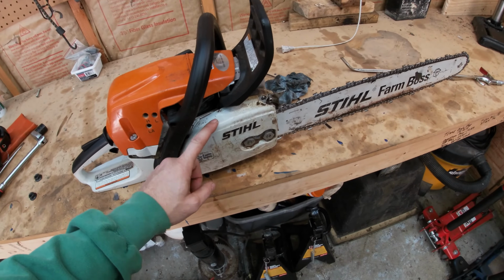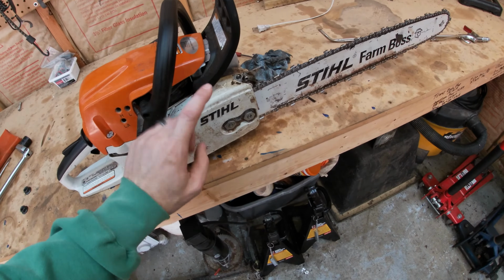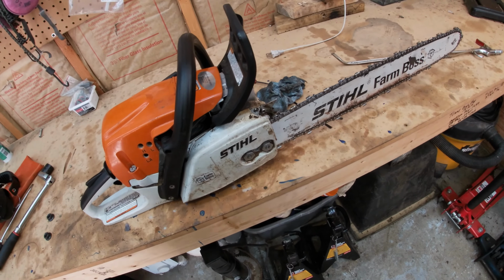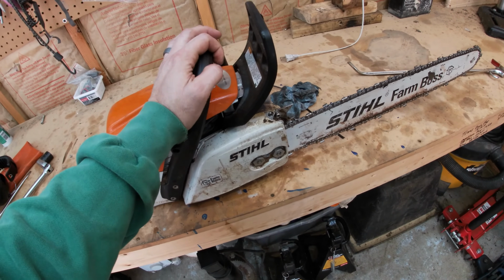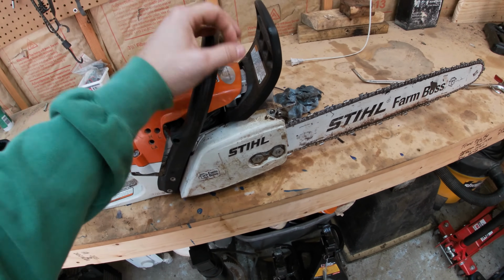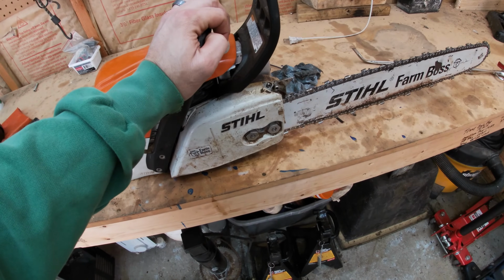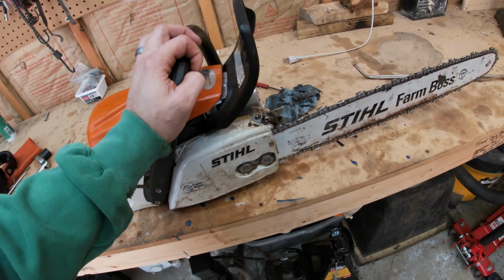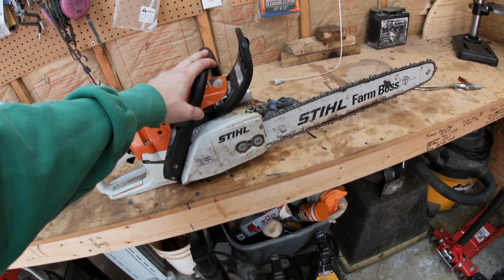So if you got a Stihl MS271 chainsaw and you're wanting to get a little bit more oil to the chain and the bar, you can put a restrictor in that top hole. I used an O-ring, and that should get you a little bit more out there. Hopefully this might help somebody else that's having the same issue. Thanks for watching.